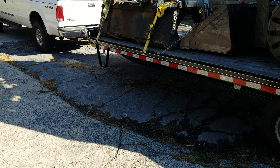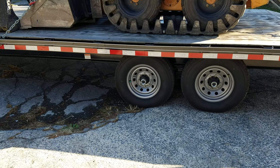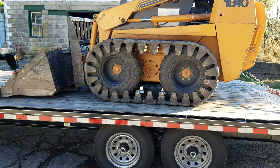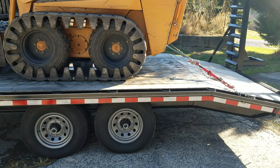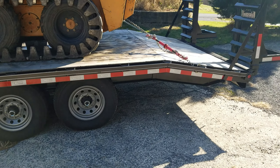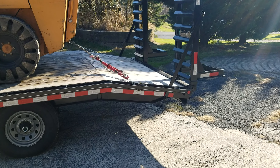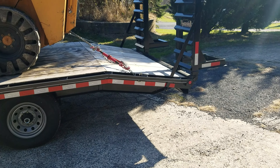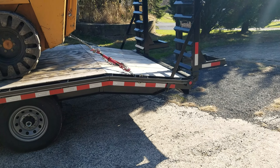Paint — I was warned about Kaufman's paint before I ever bought a trailer. Two things I was told: warranty and paint will be your biggest issues. Luckily I fixed the wire myself; I wasn't dragging the thing back to North Carolina to make them fix it. Also, the tag light is grounded to the steps, so when you grease that rod really good so the ramp slides well, you lose your ground and lose your light. That's something I'm going to have to take care of.